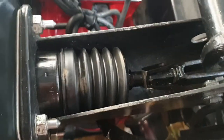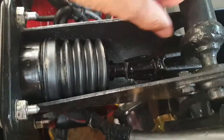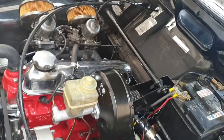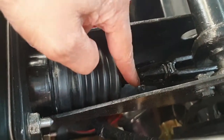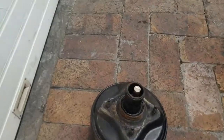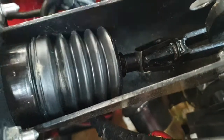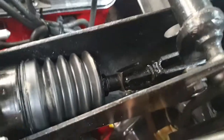Starting at the back: we found that the shaft at the back of the booster didn't quite reach the linkage that goes to the pedal. This is the model with the booster sitting on the engine side of the firewall. What we did was cut off the little shaft at the back of the old booster and welded that onto the linkage of the replacement booster, which is from a Golf Mark 1.